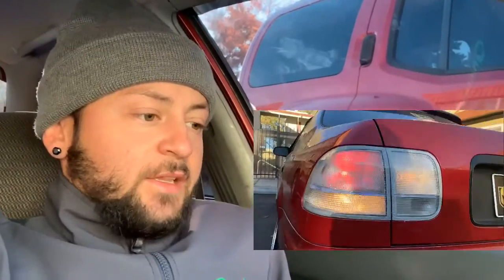They look super sick, especially on the red. It looks pretty nice. One downfall though: when you run clear taillights, you're going to have to get LEDs or find a bulb that's the same color for the function that they do. As you can see on my taillights, the running light is red, which is also the brake light, but that's because that's an LED fast flash bulb. But the reverse, turn signals, and the other brake light and running light all have that same halogen looking color.